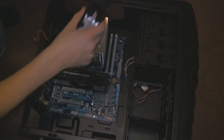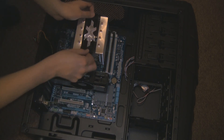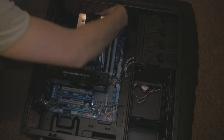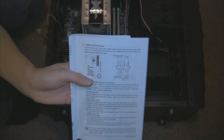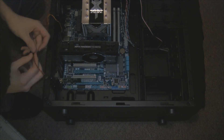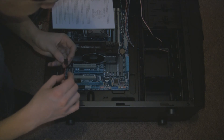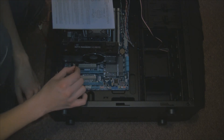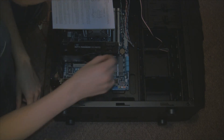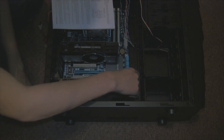We'll now move on to adding the CPU fan. You can't fit the fan whilst fitting the cooler because it would obstruct everything, but you can add it in at any point — just make sure the air is blowing the right way. Now take careful note of your motherboard manual as it tells you where to plug the case connectors in. This covers your power button, reset switch, and various lights. Here I'm plugging in the speaker with reference to the motherboard manual, which tells me the exact pin arrangement to plug everything in.